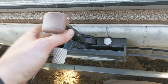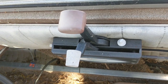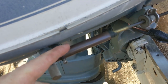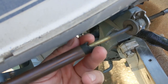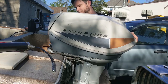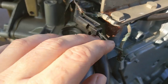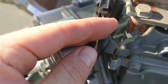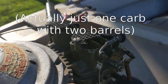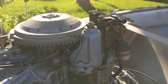Some of the controls work, so that's a good start. I think the shifter is bent back on the engine. I don't even know what kind of redneckery is going on with this shifter — I think this is a piece of copper pipe. There's something broken here so it doesn't actually want to shift very well. Looks like the mice have been at the wiring, which is always fun. It's a four-cylinder with two carburetors, and if you've watched any of my former videos, you know how much I love carburetors.